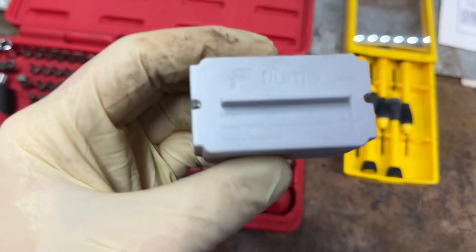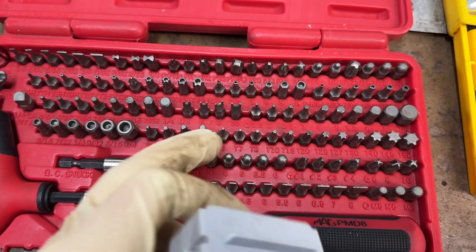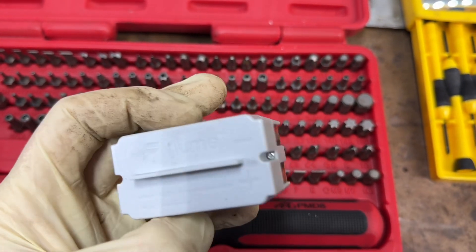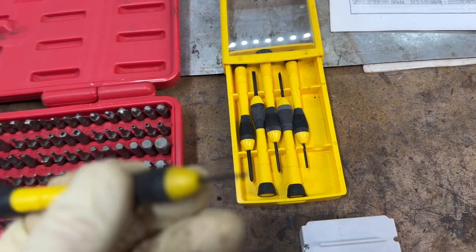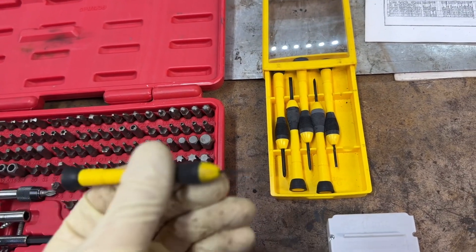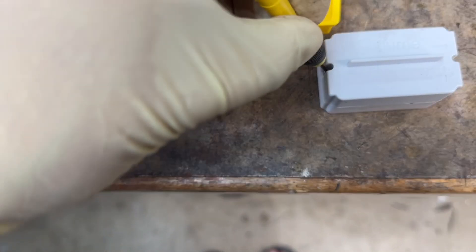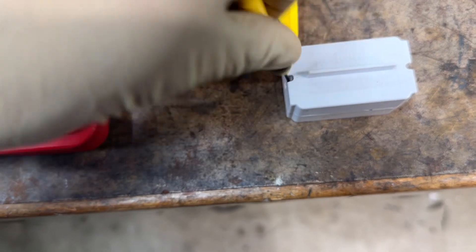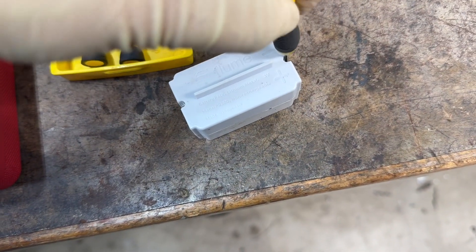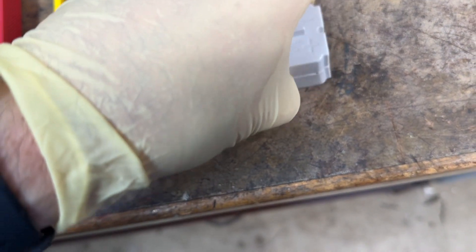These are probably a T5 or T6. I can't get my bit in here because it's too fat to fit down in there - you have to have a bit with a small shank. I just used a little tiny flat blade because they're torx. I was able to loosen these screws with just a little tiny flat blade jeweler's screwdriver. They're not going to be very tight, so I should be able to crack this thing open.